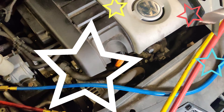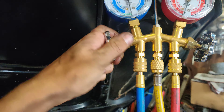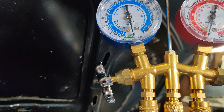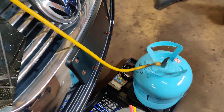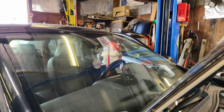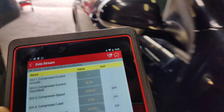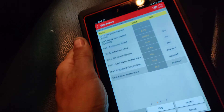Okay guys, it's been like two weeks since I diagnosed this Jetta, and I just took my gauges back up. Now my gauges were at zero PSI when I hooked it up, because the hose that I have to use right now doesn't have a check valve. But it was pulled down to like 20 inches - that's pretty amazing because you got to think of how to pull a vacuum on these two when I hooked them up. That means we should have no leaks - it couldn't leak under pressure. I was looking at this clutch - it looks really funky. I got the lines undone, I got to bleed the vacuum off because I can't get the lines off because they're sucked on. They're really fat lines on this apparently. So I pulled a vacuum on here for like a half an hour, so I'm going to shut this off and we'll come back in two days and see if there's any leaks. Because right now it's really late. Seems to be no big leak right now, but it'll probably be like two days.